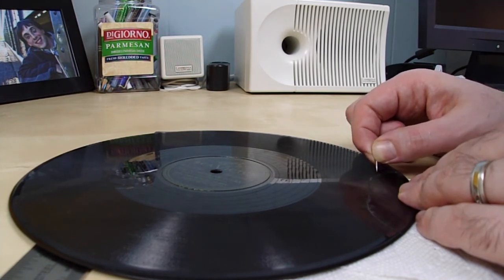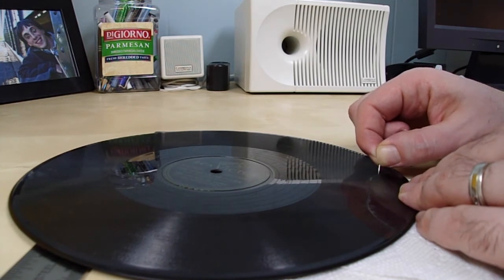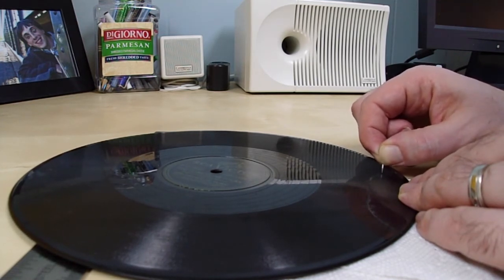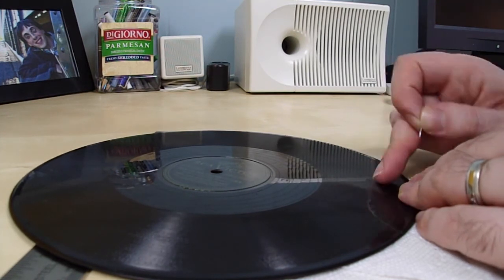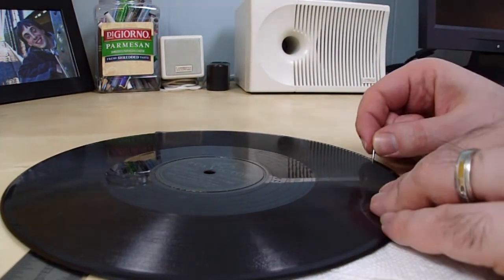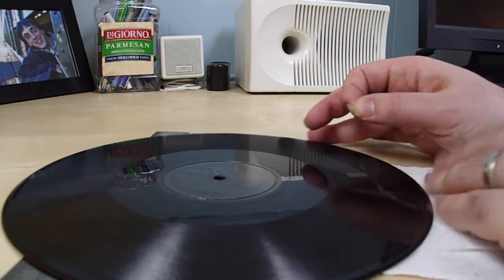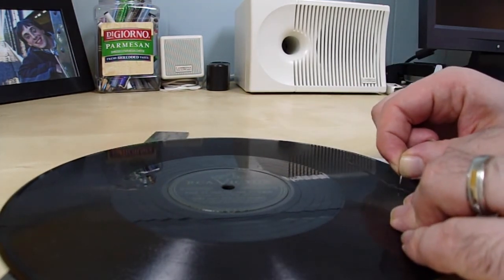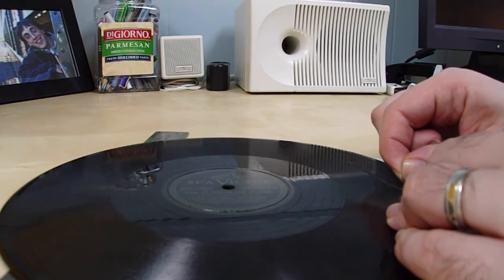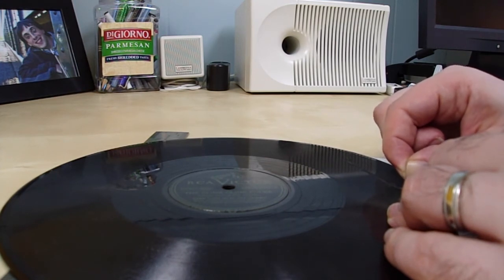What's happening is somewhere — I think it's glue, although it might be the crack — is causing the needle to repeat itself over and over again along the same line. And if we remove the material that's causing that, it should play straight through. In theory. Now we don't want to cause too much damage. Although admittedly every line it's still a pop. It's only one pop you really hear, so I'm thinking one side of this is okay and the other side not so much. Maybe I should look at it again to see if it's the leading edge or the trailing edge of the crack that's causing the pop and the problems.